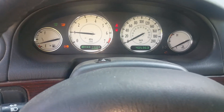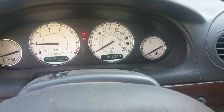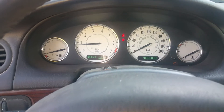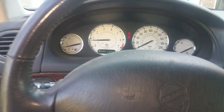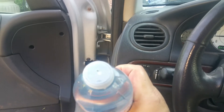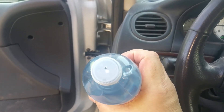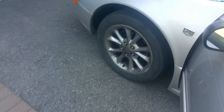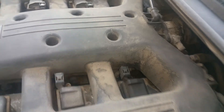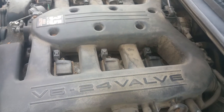The check engine light comes on, stays on, and gives me the tone. I have this water bottle with a small hole drilled in the top, and I'm going to squirt it around the manifold. I already did this before, so I know there's stuttering over here — I'm just going to go right to that spot.